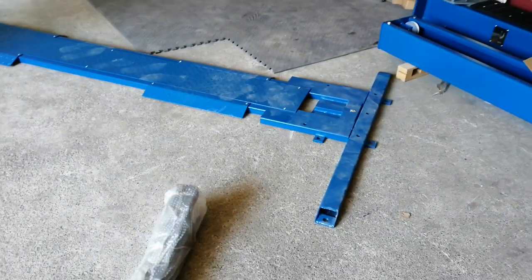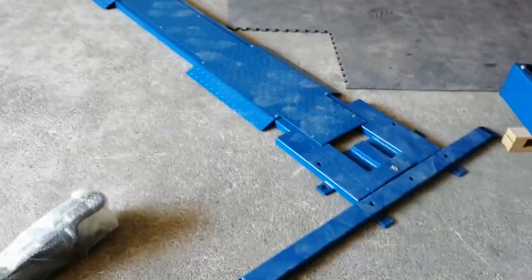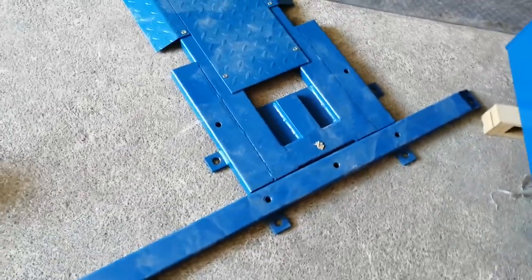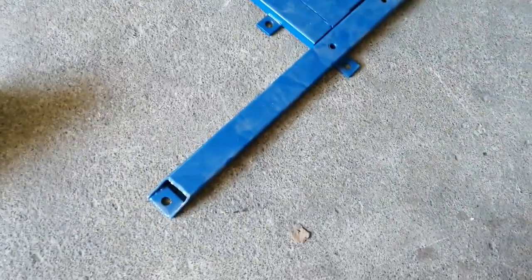The reason I bought this one is because I only have six inches of concrete here, and this lift requires a minimum of four, so I was recommended this lift. As you can see, it has extra bars for extra support and comes with 12 bolts. I used a drill bit marked at six inches to check my concrete depth — drill until there's no resistance and you've run out of concrete, so I confirmed I have six inches. For this lift I'm going to be drilling five-inch holes.